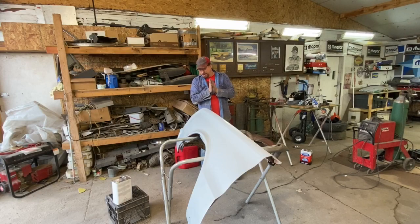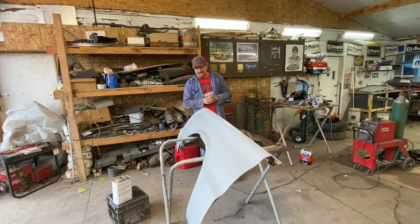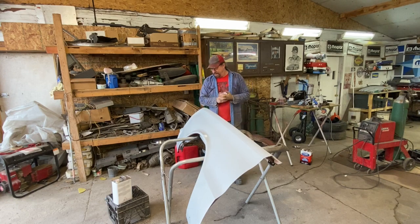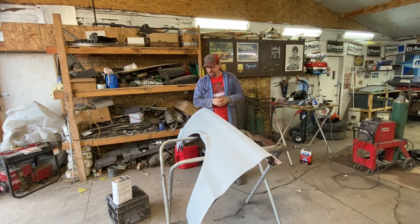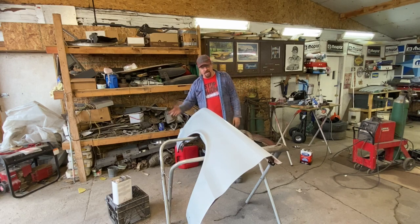We have a couple of coats of the polyester on there. It needs to dry for an hour at least. It's going to be drying for longer than that, but it's already drying to the touch in some spots. I tend to get a little carried away with that stuff and flood it on pretty good, so it takes a little longer to dry, but it's fine. I know they say you're supposed to put lighter coats than that, but I've always just put it on with a fire hose. As long as it's not running, it's fine to me. Especially when it's over just etch primer like that.